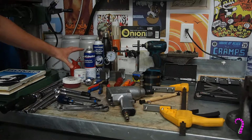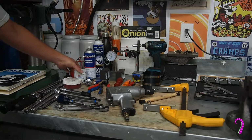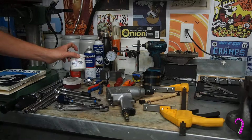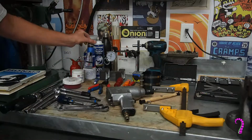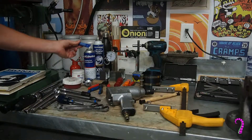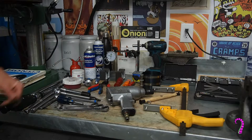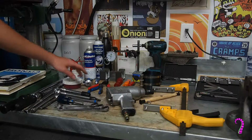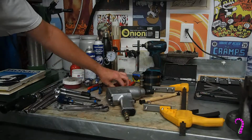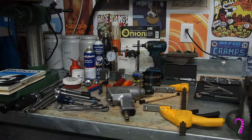As far as lubricants, we're going to use some assembly lube at various points. We're going to need some valve grinding compound. It's going to serve a specific function when we go to lap the valves in. Got our Permatex gasket maker. We're also going to need thread locker. This is the blue. We're also going to need the red, strictly for the cam sprockets, I think, but again, refer to your manual. We need snap ring pliers here as well. Trim clips, picks, other sorts of implements to get into some awkward situations there.